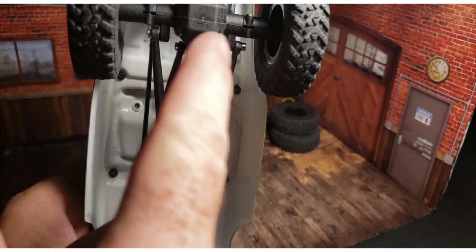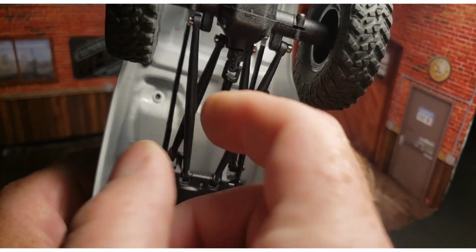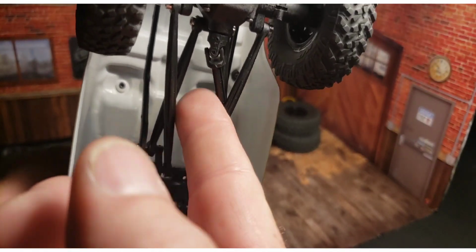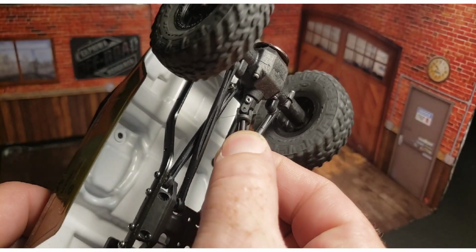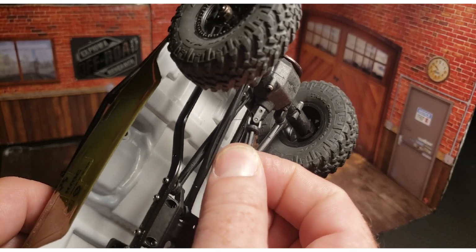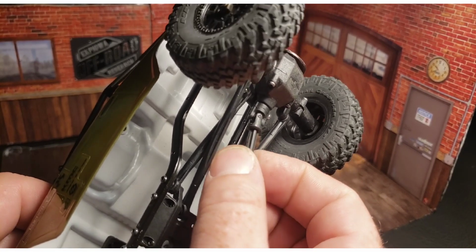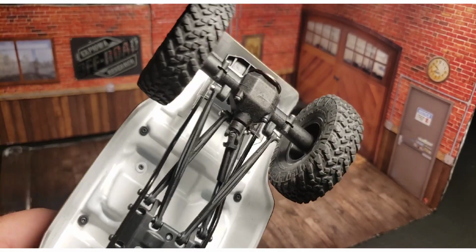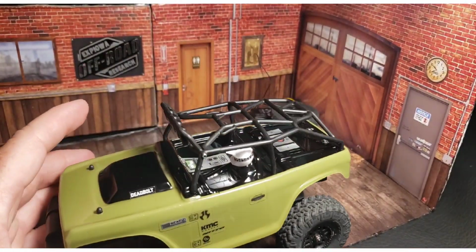I'm sorry, drive shaft and axle. I have that center yoke in there that holds these two pieces together. That's from a SCX24, because the Enduro24 center yoke there between those at that pivot ball, they're just too weak. The little things on it come apart, and you'll blow the drive shaft apart right here with the 2S battery. So that's it for now.